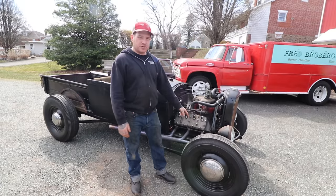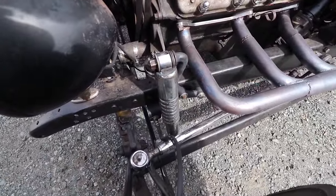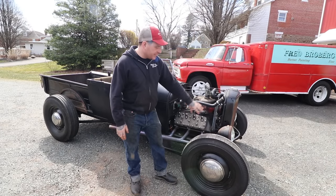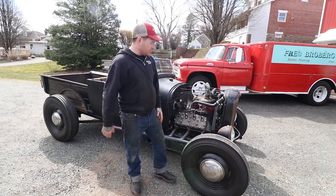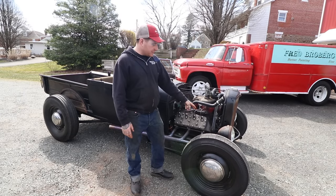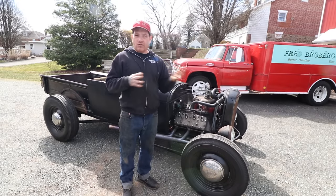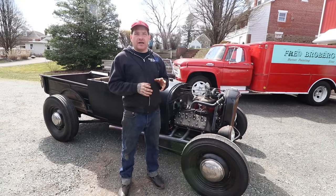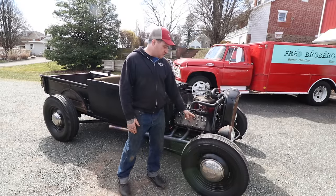The shocks on this are a set of tube shocks that I've actually added. These are modern chrome tube shocks that we added old '50s or '40s chrome ribbed chrome exhaust tips onto. I TIG welded a washer on there with our mount, and now the tube shocks look old school like the old aircraft ones that would have ribs or a shield that goes over top. We used F1 Ford pickup shock mounts on this that are just heated and bent to fit the frame — that is the most common way to do shock mounts when converting over to tube shocks. Cars in that '48 to '50 time period that we built this truck to had tube shocks on pickup trucks that you could walk into a dealer and get.